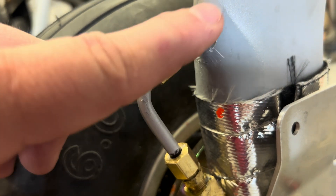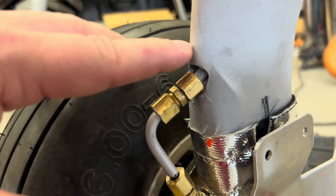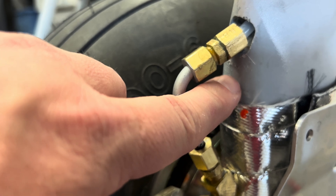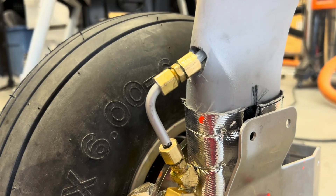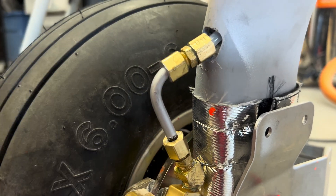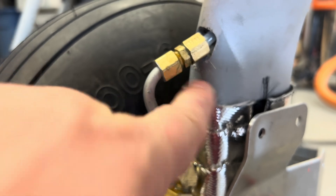What I had to do is I drilled a hole that was a little bit higher on the gear leg, but it's still going to be covered within the wheel pants without a problem — I got the wheel pants out and measured how they fit. The hole that was normally here I filled with epoxy: I got a syringe, mixed up some super fill, and pumped it in until it started coming out the other side. There's just a passageway that Sling added into the gear leg for the brake line, and when you re-drill it you're just tapping into that same passageway. It was easy — took just seconds to drill, then I filled it with epoxy and sprayed some primer over it to protect the epoxy.